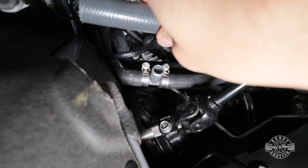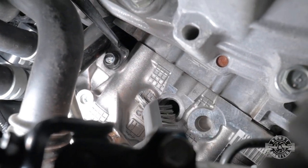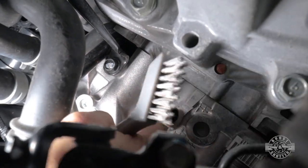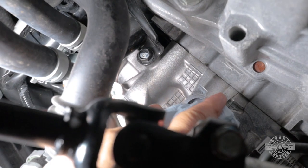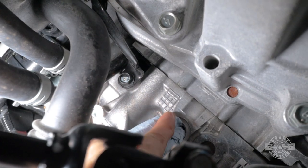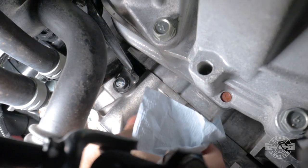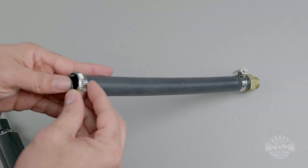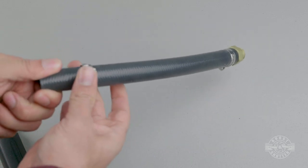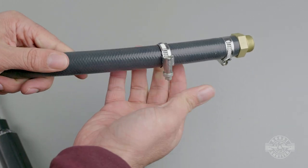When done, remove the cooling mod hose and take it to the bench. Grab a wire brush and do your best to clean the opening of all the thread lock that was on the plug. When satisfied, grab an absorbent rag to completely dry that opening of coolant — I'm using a glass cleaning wipe because they're absorbent and don't give off too much lint. Be extremely careful that nothing goes inside the head. If the hose didn't come with a metal band over the barb, make sure you put one of the included worm gear clamps on there, and loosely pre-stage another clamp on the hose.